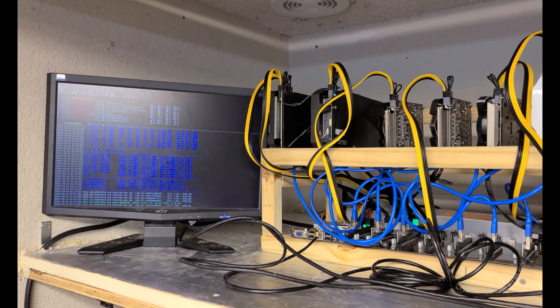I need to put a vent cover on the inlet, but I'm going to go inside and start tuning and get all the overclock settings dialed in. I'm going to put an ambient temperature gauge inside here so I can monitor not just GPU temps but how they relate to the ambient temperature inside the cabinet. I've got ethernet going through that switch to both motherboards. On the left you can see that 220-volt twist lock going to the PDUs. This is the first video I've done like this on my channel — usually it's cars and fixing stuff. I also do chia farming and maybe I'll do a video on that. If you have any questions put them in the comments — thanks for watching.